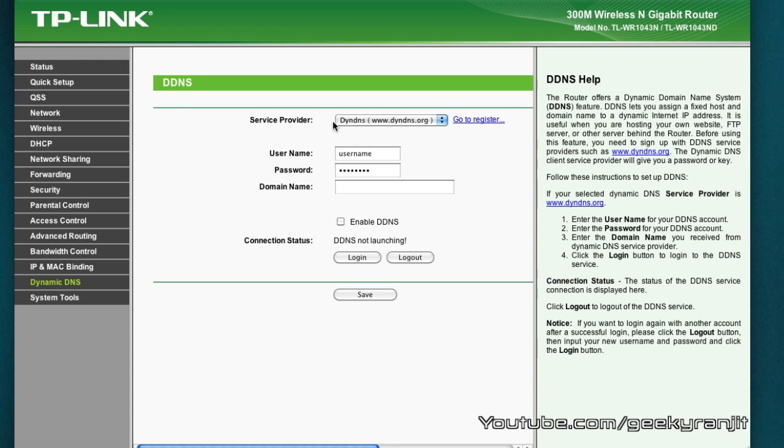The most important thing while testing a Wi-Fi router is the range. In this aspect the TP-Link router excelled. I've divided my apartment into four zones — A, B, C, and D — and test all routers in those zones. Generally all routers perform great in zones A and B, but zone C is around 33 feet away with two physical walls, where some routers start to show weaknesses.